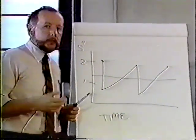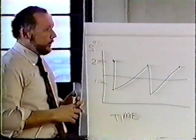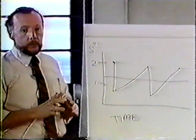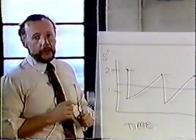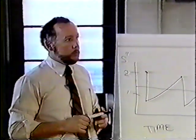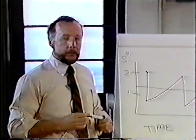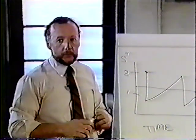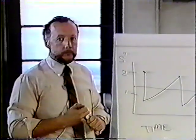You may not see an increase in lining wear if you were doing good manual adjustments. The fact of the matter is you won't have to get under there and adjust an automatic slack adjuster. It'll do it on its own. It does have a grease fitting. We want to give that a shot of chassis lube every once in a while to keep the salt and the dirt out of that slack and give it a little bit longer life on the vehicle. However, you should never have to adjust an automatic slack adjuster if it's doing its job properly.